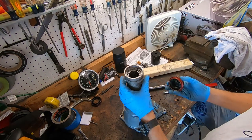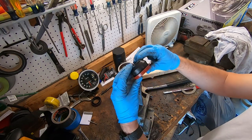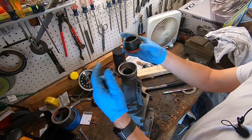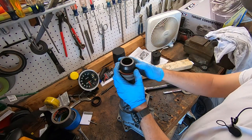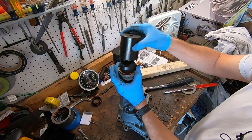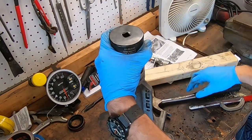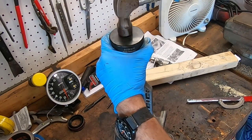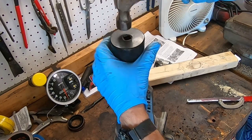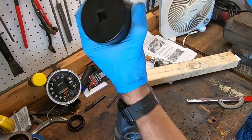Now we're going to tap the seal on the back of the tail shaft housing. This seal has an extra rubber boot on the outside — it's a Timken piece — which I thought would help keep some extra debris out. Since I don't have the correct tools, I'm using a hub removal tool from a '95 F-350 that fits around it perfectly. Give it a couple of spins — and there's that solid clink. That's it.